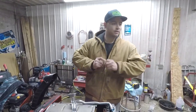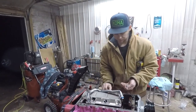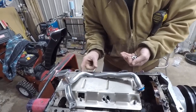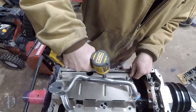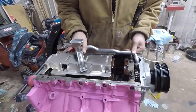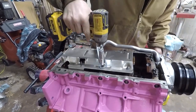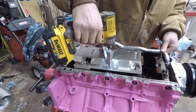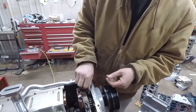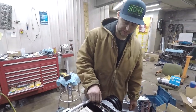Here's where I lose audio again — some clips have audio, some don't. Anyway, I think I paid too much for the pan. You can get them pretty cheap — look for a Savannah or a Chevy Express, they use the same pans as the F-bodies. Look up what this one looks like and then look up a Savannah or Express — you can find them pretty cheap on eBay. Also, the front bolts near the balancer — the studs — you can trim those too before you torque your crank down; it'll give you a little bit more clearance, but you don't really need to since it still clears the pan. That's about it. There'll be a short part two to this — I know it took a long time to get this out but I finally got it out. More to come, so yeah, come back sometime.